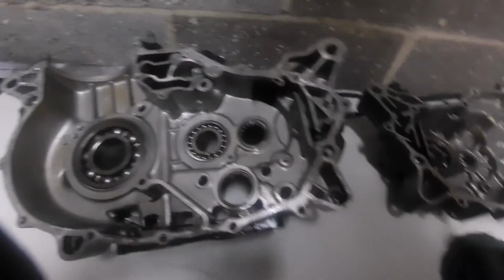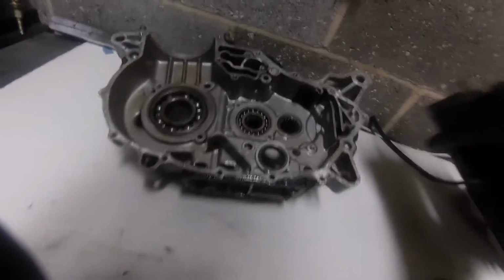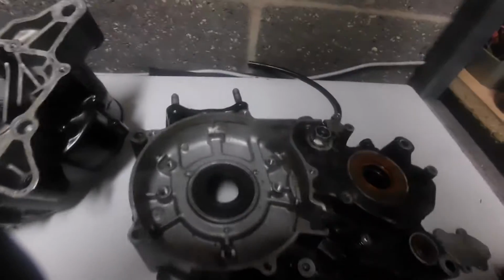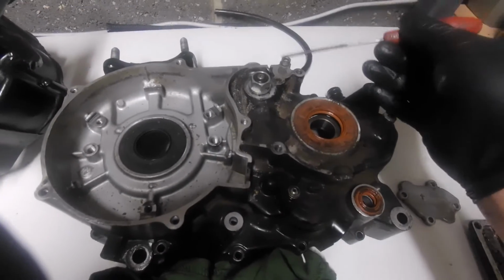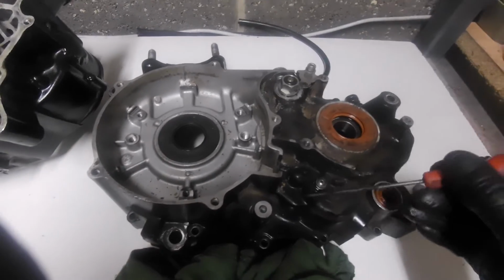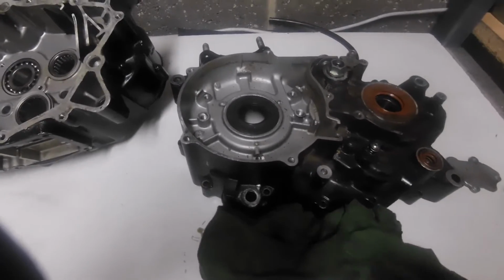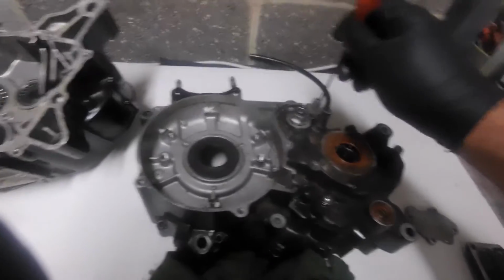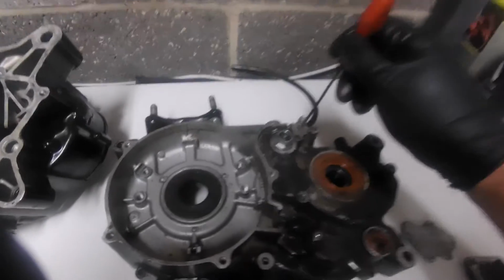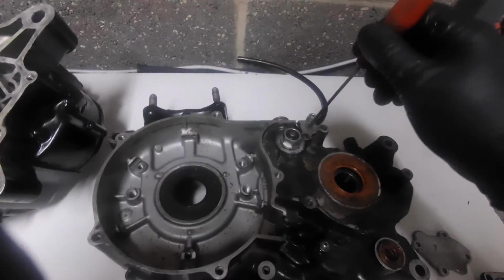But before we do that, let's just have a look at if we can keep hold of it with oily gloves. Now, originally, your oil pipe on your XT500s has a little curved pipe here coming down, bounce around here onto there, I think, and then comes from the bottom of the oil tank. So essentially in and in. That's the feed for our pressurized oil that's about to do some work. It's been sent back to the tank by the scavenge pump, but we actually need it here in the first place. That makes sense.